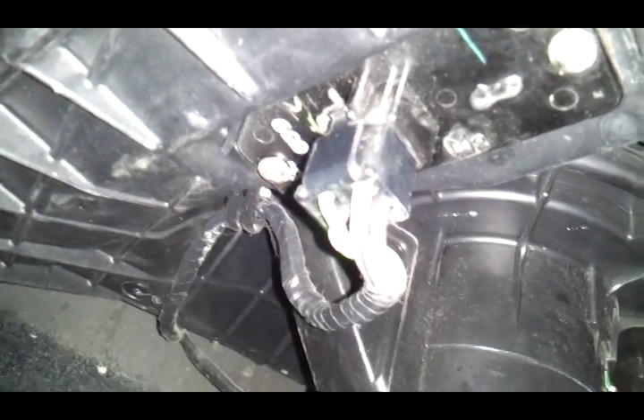Working on a 2003 Dodge Ram 2500 diesel. This is where I'm under the dash on the passenger side looking up. There's my heater fan blower. Right in front of it is this little doodad — two screws and a plug. That is the heater fan or HVAC fan resistor. And if that thing goes bad, you don't have any speeds — you only have high. It only runs when it's in the high position; it won't run in the lower positions.